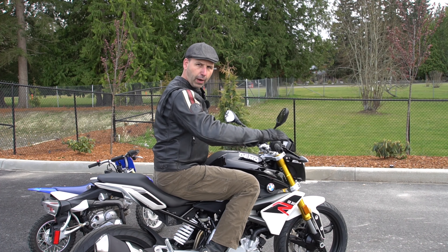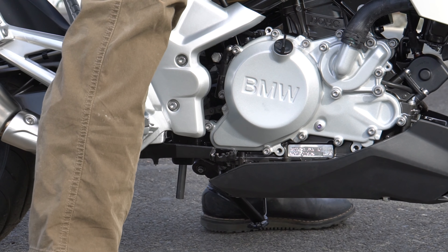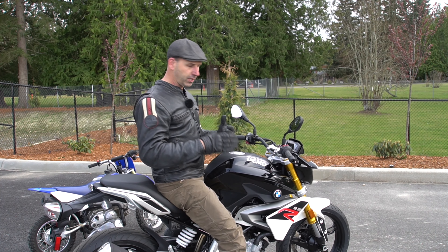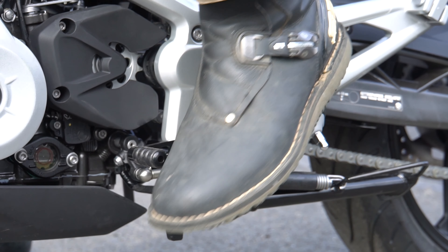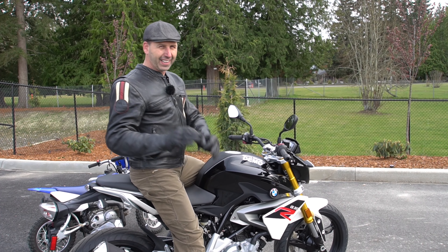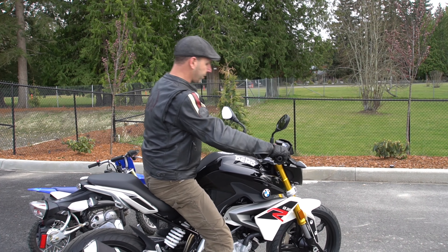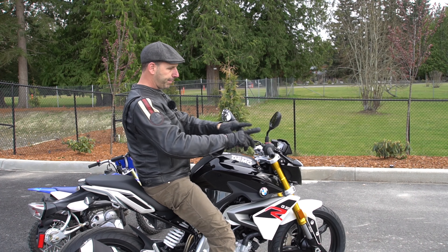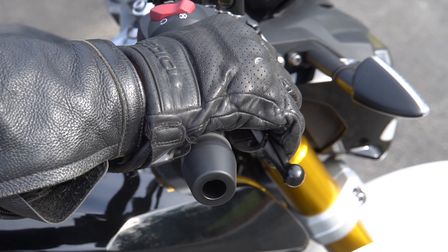There are four major control points you're going to have to touch while riding your motorcycle. On the right side, this is your rear brake. When you put your foot up on the peg and you're sitting forward in a riding position, make sure you can operate that rear brake. On the left side, it's the shifter, and it has to move up and down to change gears. Sitting forward on the motorcycle, make sure you can put your foot above and below that gear. If you sit way back to shift, that's not going to work for you — that's really important if you're riding a dual sport or adventure bike.